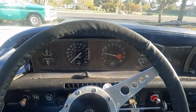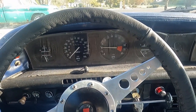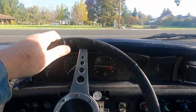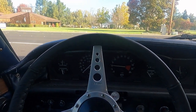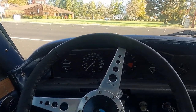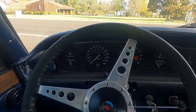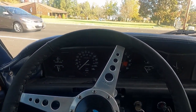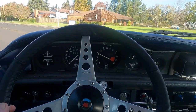We've got the car started — you can see the tach's running nice and smooth. It's also a decoded digital drive speedometer, so it doesn't actually start to work until you're doing about 10 miles an hour, which is a little annoying, but I didn't really have a choice. I had to use a drive for a cruise control, so it doesn't have the strength of output that the normal drive would have. The normal drive comes off the tail shaft of the transmission and replaces a cable-driven speedometer drive unit, but this transmission doesn't have that — the Land Rover drove out of the rear axle because of the transfer case.